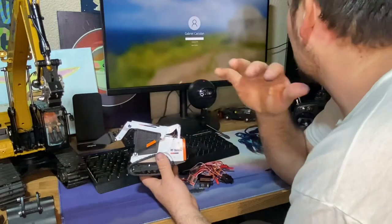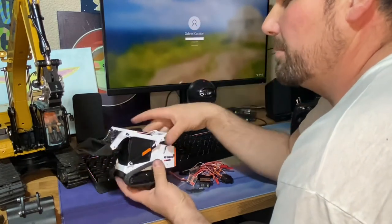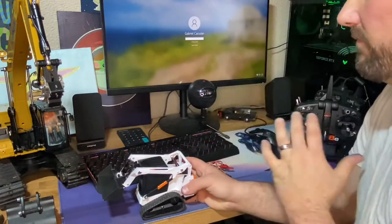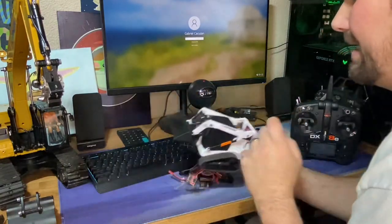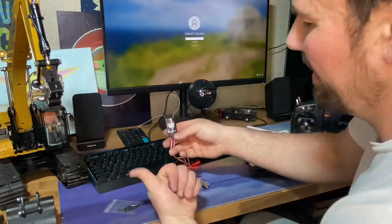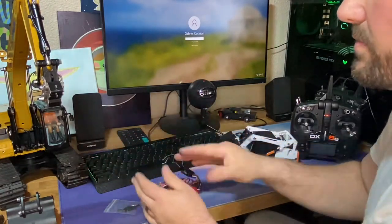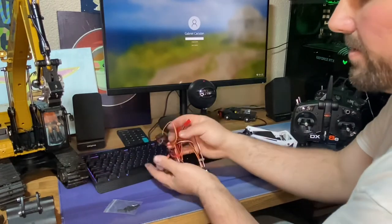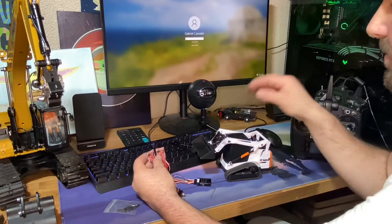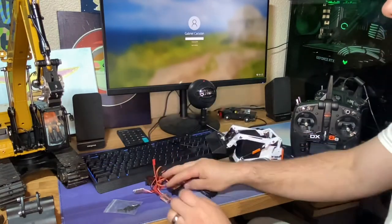I'm definitely doing its first dig video for sure, 100% — and then I'm going to put it through tests and stuff, see how it performs and how capable it is. First I'm going to do the first dig video to show you how it does before I put it to some torture test and break it. That's why I really want two more of these — one completely brand new sealed in a box for once I get my prototype dialed in. The next one is getting these electronics. I'm probably going to go a little bit bigger on the battery but it's going to have six channels, probably have lights, and may have a sound box. It's going to have separate ESCs because I feel like I can control one side independently — it'll be a little bit smoother with a load, with an off-and-on switch. I think that one in here is a 2x5, so 5 amps per motor. These can push 10, so you've got to watch on these little motors — the 2-in-1 might be a better deal. Let me be the one to experiment with these before you burn out your Bobcat.